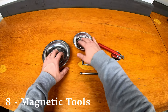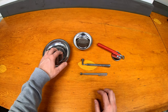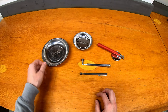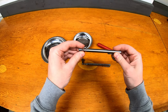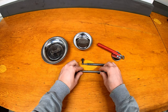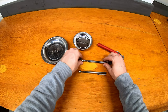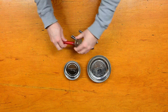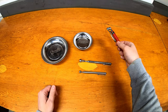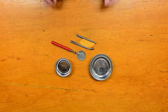Next up at number eight is a bunch of magnetic stuff — magnetic trays and extendable magnetic pickup tools. The magnetic trays are great for keeping screws, nuts, bolts, and anything else from rolling away. They'll stick to the bodywork of a vehicle under the hood, on top of an engine, or just sitting on the bench, and if you bump them the fasteners don't fall out. The magnetic pickup tools are especially handy if you drop something — they extend out so you can reach into small spots and pick up anything magnetic. They come in different styles and magnet strengths. Often these come in a kit with a mirror on a stick so you can see behind things you can't get your head into. Very handy for keeping you from losing things — and then finding and picking them up again.